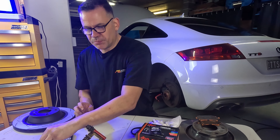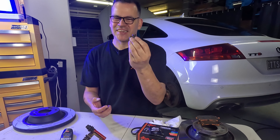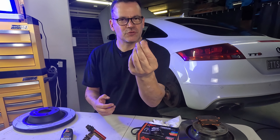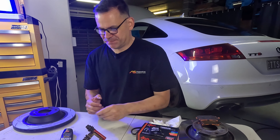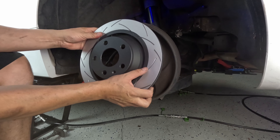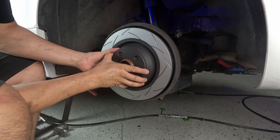When you put your calipers back on, note that the two bolts are one-time use, as is the little grub screw that holds your disc rotor on. It's time to put the rotor on — I've given it a wipe down with some brake cleaner. There's actually quite a lot of crud on a brand new disc so it's important to do that.